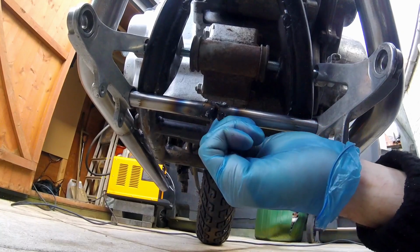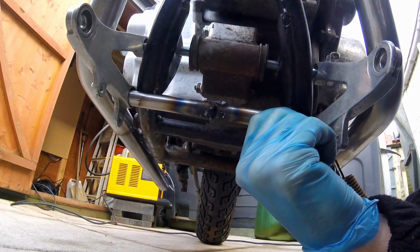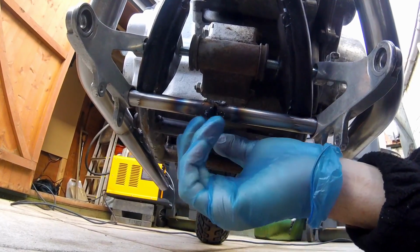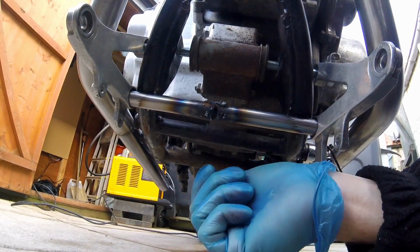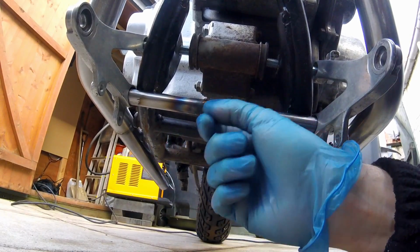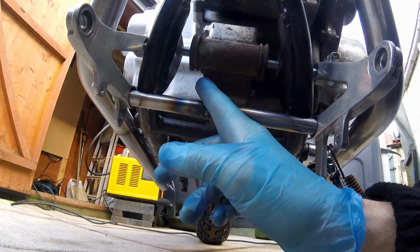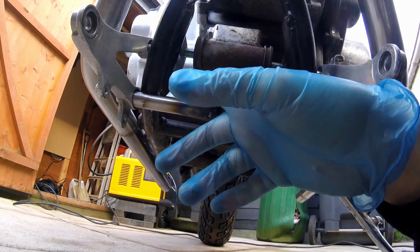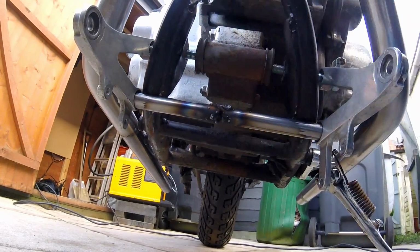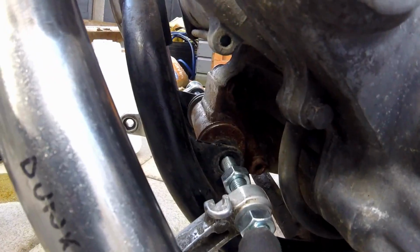So what I did in the end was just cut the tube in half, do one side, get that sorted, do the other, get that all fine, and then roughly weld it back together on the right angle bit of metal in the shed, so it's squared up, because obviously I wanted it squared up to the frame as well. Threaded bolts through the top, that'll need some spacers on. I've got some alloy bar that I can make some spacers out of, so that's no issue.